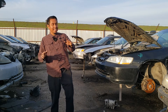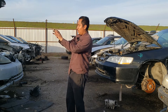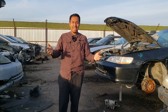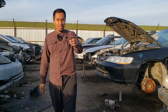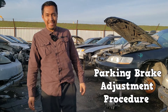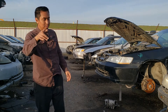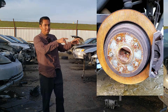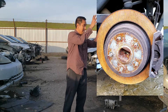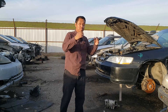And don't let terms like screw-and-nut adjusting caliper or ball-and-ramp style caliper throw you off — these are easy mechanisms. For the test, know the general procedure for adjusting the brake. And eventually you'll run into this design: a drum-in-hat rotor. This design blows my mind, because you have a brake drum design inside of a disc brake design.